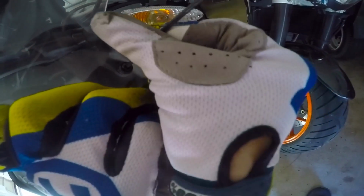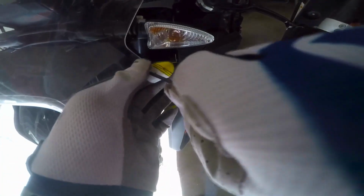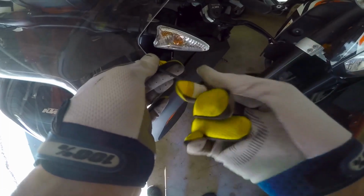That's the trick when you're installing something that's got a bolt pattern, in the sense that this has 4 screws that hold it on in a certain pattern, and they need to line up. Usually what I do is get all of them in there loosely first, and then start tightening them up. Don't put one in and crank it down and then try to get the other 3 in, because you'll end up fighting yourself.